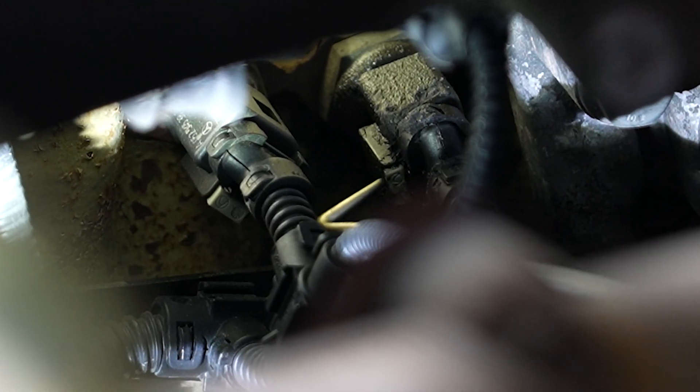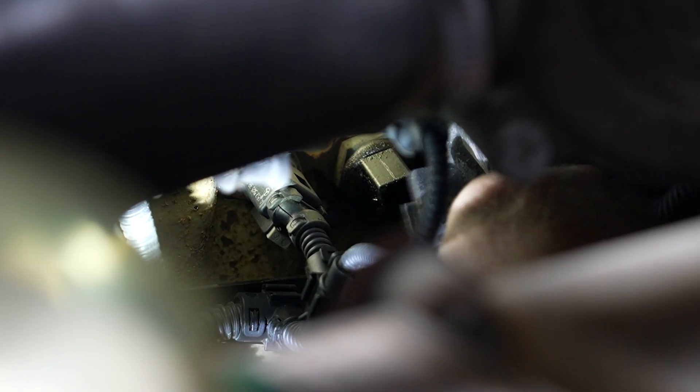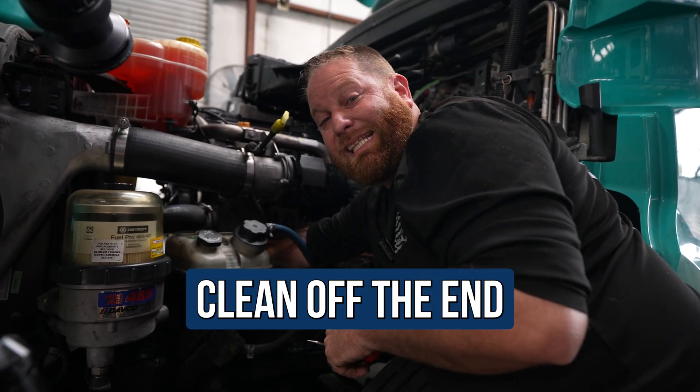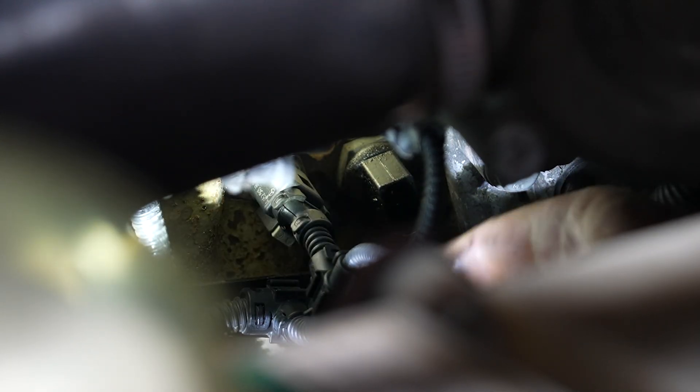I'm going to get my pick right on the gray tab — and if you can see it, it popped right out. Get my hand in there, squeeze, and I unplugged it. Right there you can see all the oil and nastiness. So before I put the socket on the sensor, I'm going to clean the end of the plug off using some electrical cleaner. Please do not use brake cleaner — you do not want to do that. Reach in and spray it around. Once done, just knock that around and it will dry fast. By the time we get that sensor out, it's going to be all dried up and we'll be good to go.